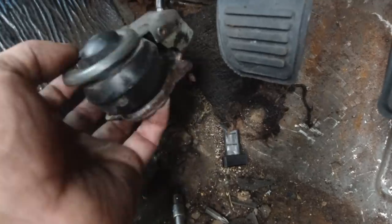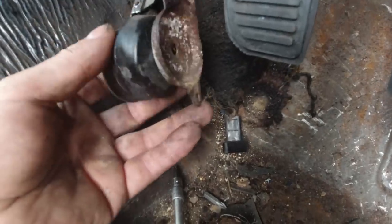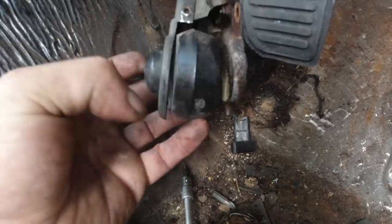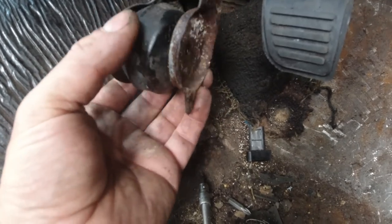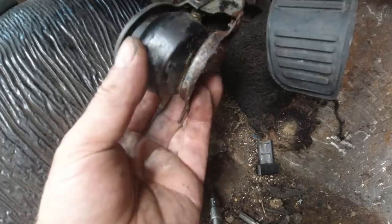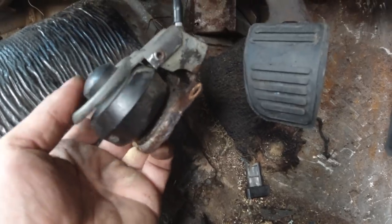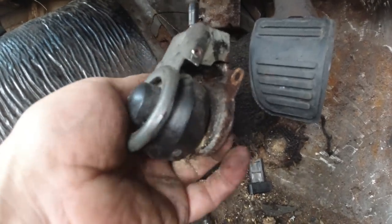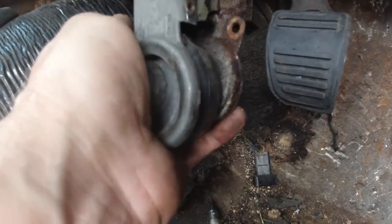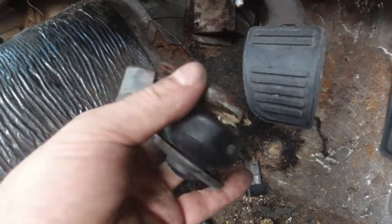Now, why is it broken away? Looks like the bolts come off. It's not a very good design, really. It has a washer inside with a bolt on it, and it grips the rubber from the inside with a washer, and then you bolt it on, and that makes it watertight. So there's that, then the switch, which does a wipe as you press. So you're basically operating a switch and you're squeezing a rubber bulb, so it's a bellows effect, not electric. The switch is just to operate the wiper, so we need to take that off.